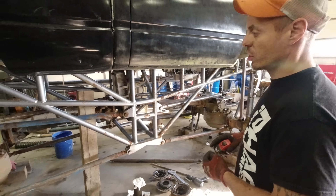My axle is at the height it needs to be, my frame is basically at the height it needs to be, and there's nothing in between yet - no shocks, no subframe. I'm going to take my tape measure and come across pretty much level. Right here at 41 inches is basically level. So now we bring it up like five inches to 36 - that looks pretty good for a link bar. This is for a lot of you guys who are just kind of winging it in your driveway.